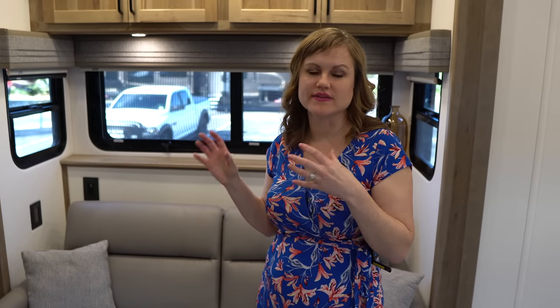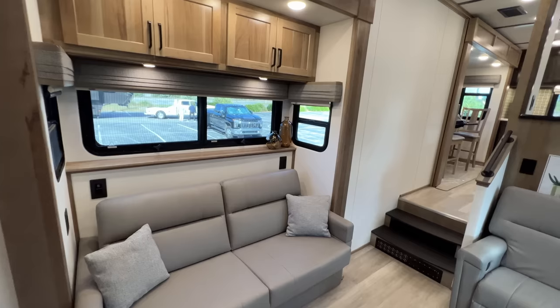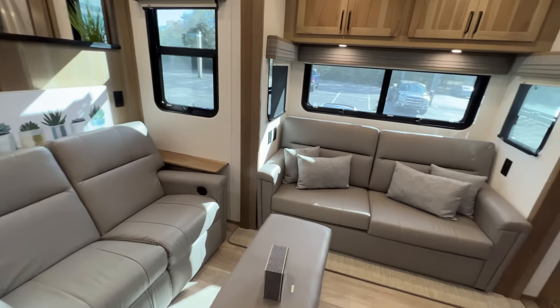You can never have enough storage, especially when you're full-time. I also want to mention that in addition to the walls and insulation, we do have dual-pane frameless windows on all of our models. Our coaches are going to be extremely winter-worthy — with the PEX lines individually insulated, the furnace ducted down into the basement, and the thickness of the insulation, they stay very comfortable all year round.